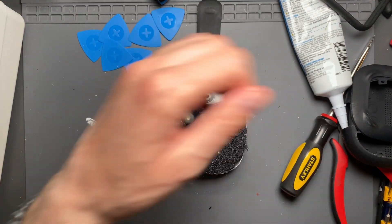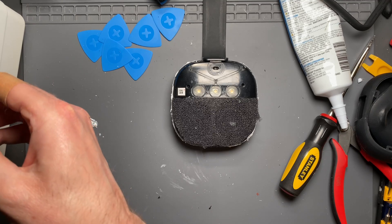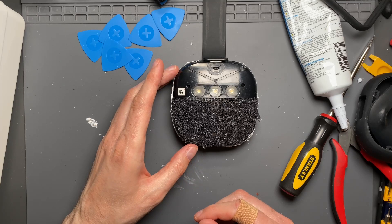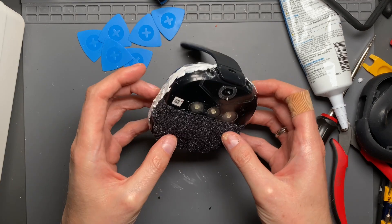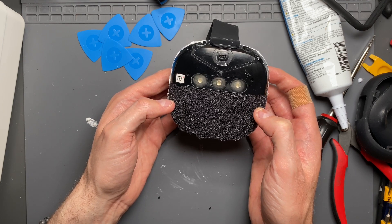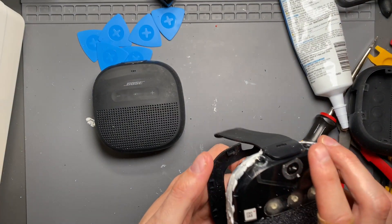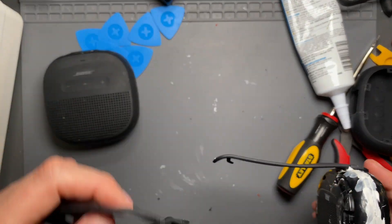Let's power this on and run it before I reassemble the whole thing. I want to make sure it's working and there's not air leaking out, and to give an indication if this is worth doing or not. So let's give it a shot. That's pretty good. That sounds pretty good — it sounds pretty damn close to, if not exactly like it did before. Let's wait for the bass to come back in again. A little bit less of a bass response, but it might be that I need to put this back together completely so that it's sitting on something and not vibrating off the bottom passive radiator, which might make the bass sound less pronounced.